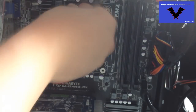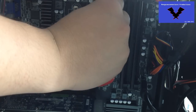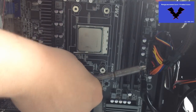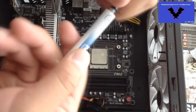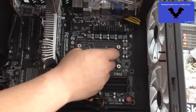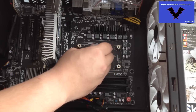Once you've placed the backplate on there, you screw the mounts for the cooler itself onto it, making sure you go in a cross pattern — tightening it, but not too much so that the motherboard bends. You just want it tightened on there, not too loose so it does not fall off onto your expensive things. So I'm just applying the thermal paste right here.